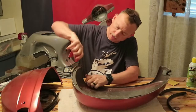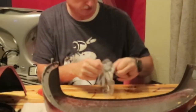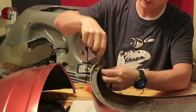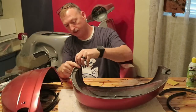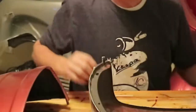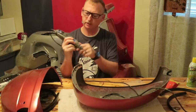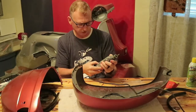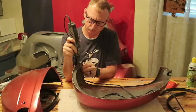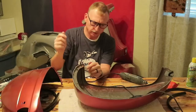Let's see if we can drop in our contact for the turn signal. Here's the contact right there - that's the little contact piece. The little connector drops in through the hole this way. I might have to put the Dremel on that because it's got some paint in there, so I'm going to trim that out with a Dremel bit that'll fit in there. So we just kind of want to slow this down - we don't need to go too fast - just clean this out a little bit. Alright, we got the little contact in.